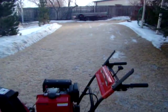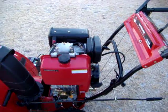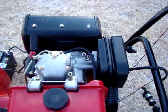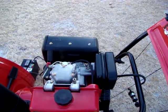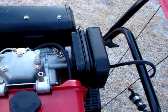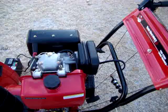It does have a glow plug on it that heats the intake air. Typically what I'm familiar with is a glow plug in the cylinder, at least for the swirl chamber designs. This one's direct injected, so I'm not sure if you can get glow plugs inside the cylinders — probably not. It'd be better to have it inside the cylinder, it just seems like it would be. I didn't try the glow plug; that may make some difference for starting. It can only help, I guess.